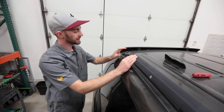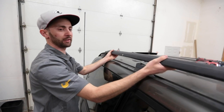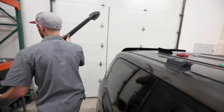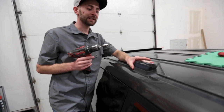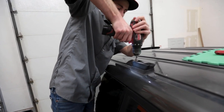After you have the front and the back loosened, you can now pull up in the middle and remove the rail. Then the last remaining piece to take off of the stock roof rail assembly is this middle piece right here — same thing, T30 bit.